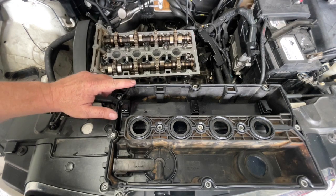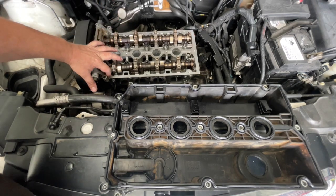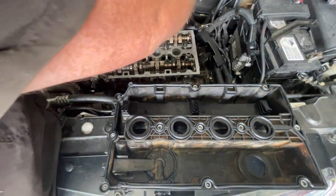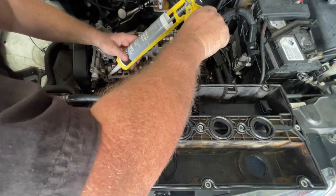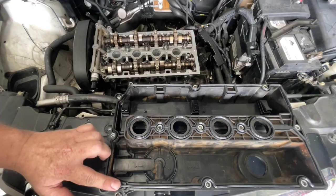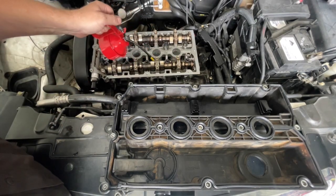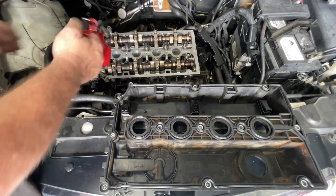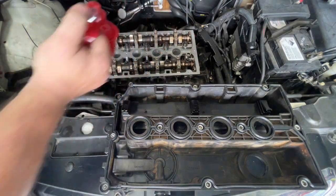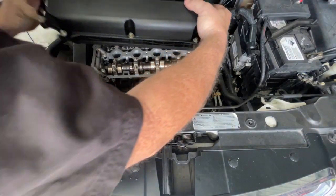I do like putting a little bit of silicone where the corners hit — just here and here. Leaks often emerge from those tight corners, so rather than putting it on the cover face I'm putting it in the groove. I'm just using some JB Weld — just a little bit, not too much. With silicone on those corners it has a better chance of sealing. Because I'm going to be starting this up fairly soon I also want to get some extra oil on things since it's fairly dry at the moment. We did test that the gasket didn't fall off when held upside down, but just be super careful as you put it back in place that it doesn't drop.